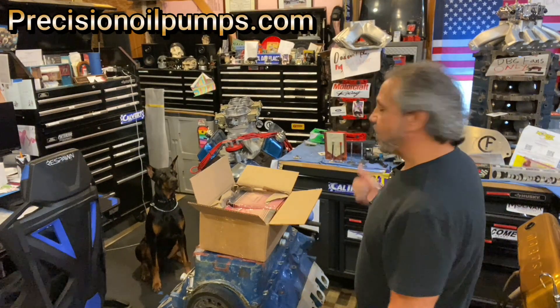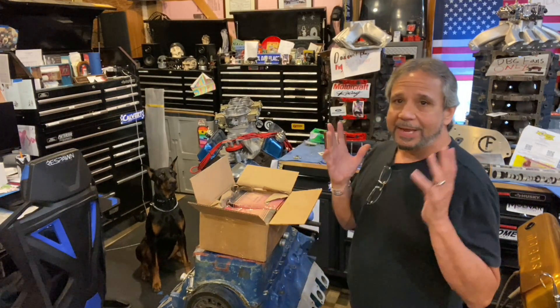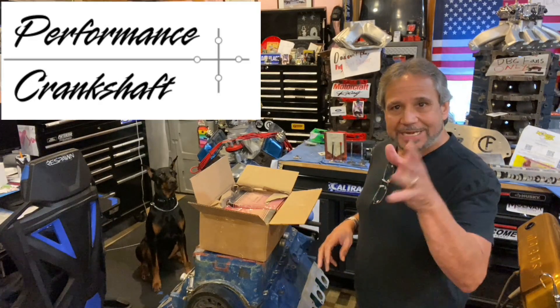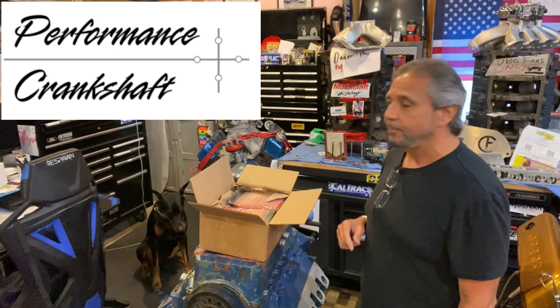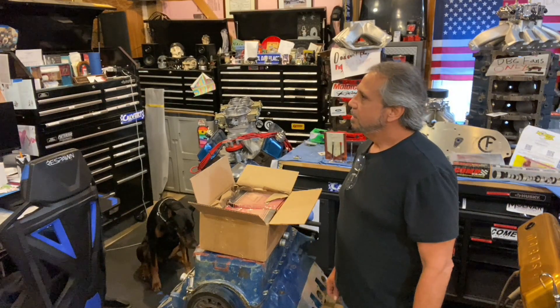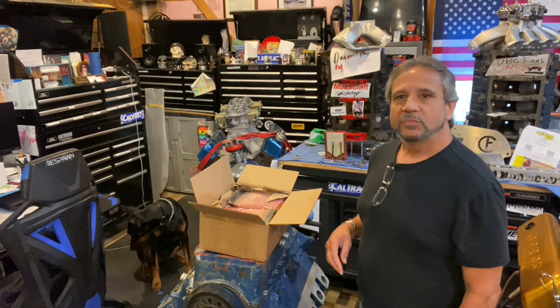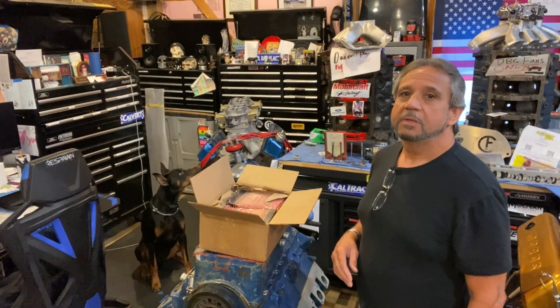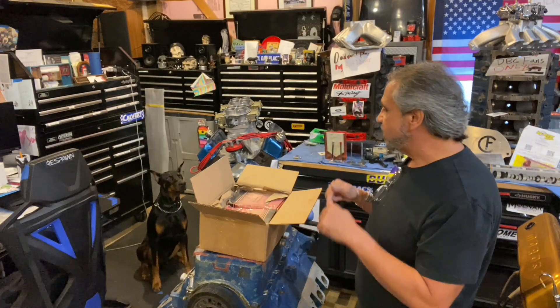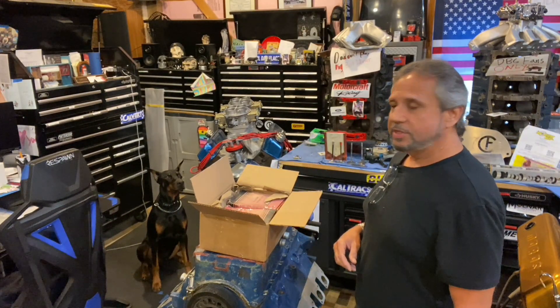Let's go ahead and tear apart this oil pump and see what it looks like inside. A quick update since I'm making this video: my crankshaft is fixed — I think it was $700 from Adney Brown at Performance Crankshafts in Michigan. That'll be shipped to Bob Beach. For the 409 Cleveland, we're just putting in new rod bolts and new coated Calico bearings. The rods are 10-under and the mains were standard, so I'm not changing anything. Bob told me they cleaned up well — he's 82, been building engines for over 50 years. I'll take that chance.